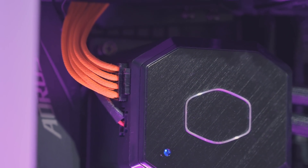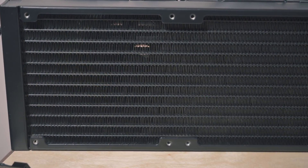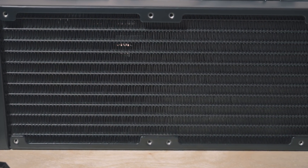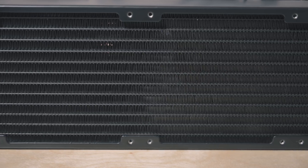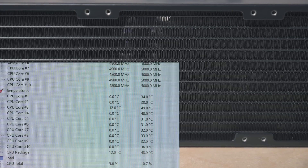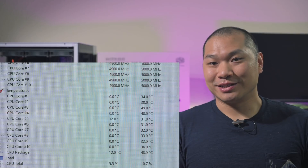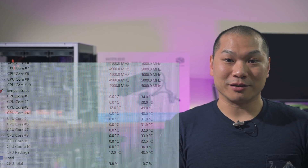When you set the cooler to unregulated, it no longer operates conservatively based on the ambient air temp — it just flat-out cools your chip to as cold as it can get. And when I did that, I saw idle temps of zero degrees. At that point you would have to worry about condensation, since that level of cooling brings the surface of the cooler well past the dew point of most room temps.